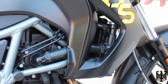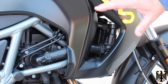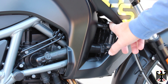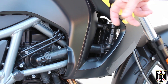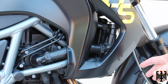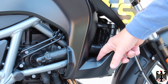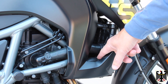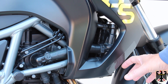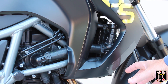The first thing you're going to do is drain your radiator. I actually rode my motorcycle for about 30 minutes, then let it cool down for about 45 minutes, and I took off the radiator cap which is located under here. It's easy to get to when you have this cover off, and as soon as you do that, radiator fluid is going to pour out. I had a container at the bottom to catch it, and then I took a pair of pliers and took this lower hose loose right here at the bottom of the radiator and the water poured out. That was a significant portion of the fluid and I caught as much as I could in a drain pan.